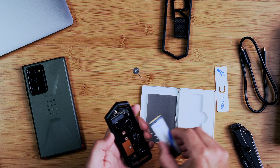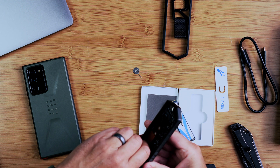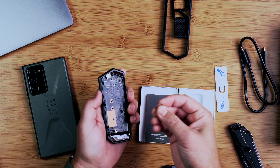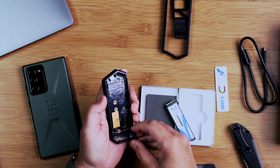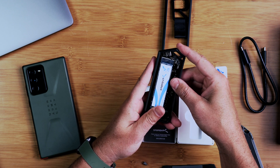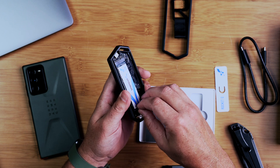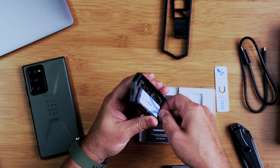We have a standoff here that will require a screwdriver — but it says screwdriver-less design, and I'm assuming that's because there are different lengths so this can fit different types of NVMe drives depending on size and form factor. I used the ejector tool instead of a screwdriver, so still screwdriver-less. We'll go ahead and slide the NVMe in — very simple. There's a slotted screw: you put the slot on the side right into the slot on the drive, lower it into place, and screw it in. It acts as a standoff and a screw all in one, which is pretty neat.